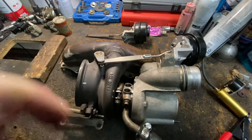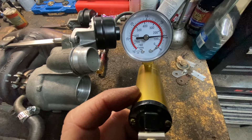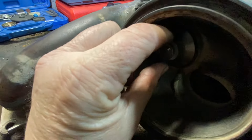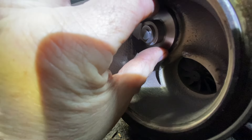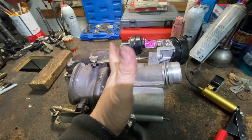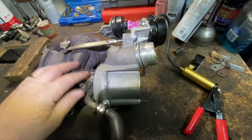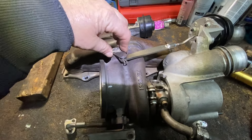Now it's all welded up nice and tight. Pull a vacuum again to just about six inches of mercury and make sure there's no play here. The disc should be able to turn with a slight drag but no play in and out. That's considered fully seated — that's how they want it — considered closed with just that amount of vacuum. The computer takes care of the rest, but that's the initial setting.